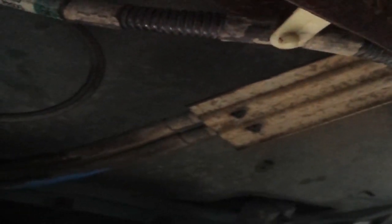As you notice, it's not grinding like she was earlier. So I'm going to say I got it dialed in, got the air out. We're going to take it for a ride so we can get the U joints in my front axle here. Just down the street. And I get that put in. Just going through the gears again. Sure, and all the gears pretty smooth. Yep. And there's no grinding. So I'm going to call that good. We'll take it for a ride after I put on the little silver boot.